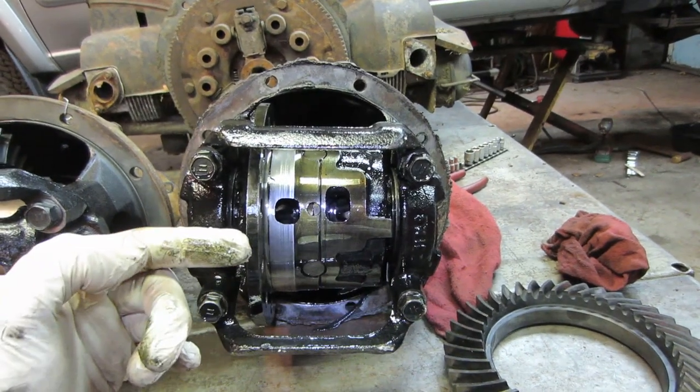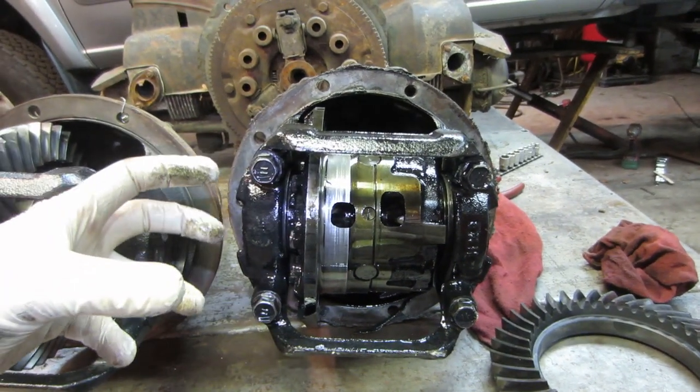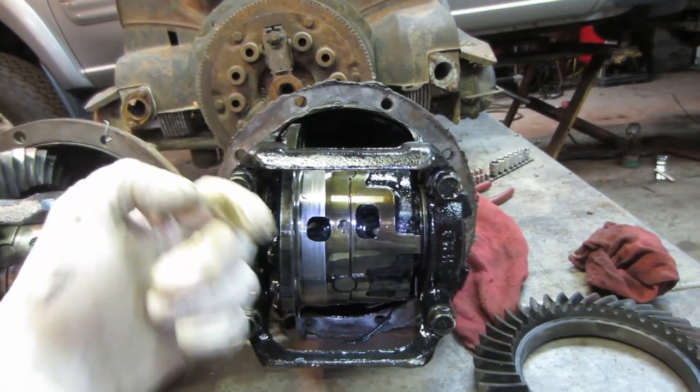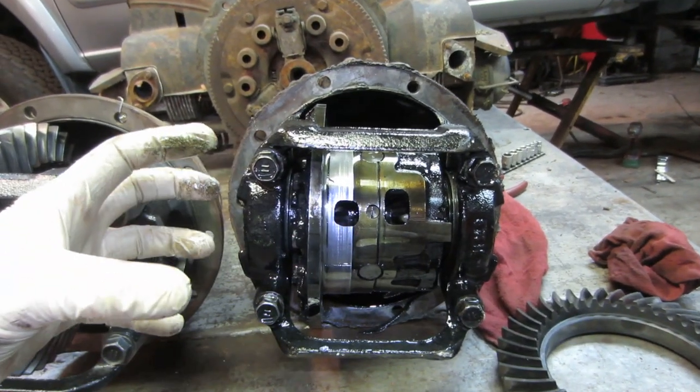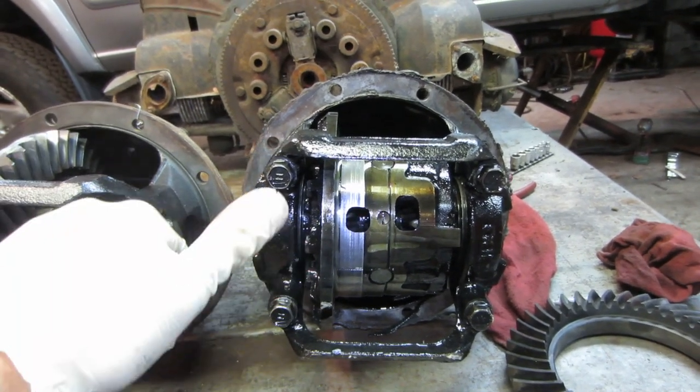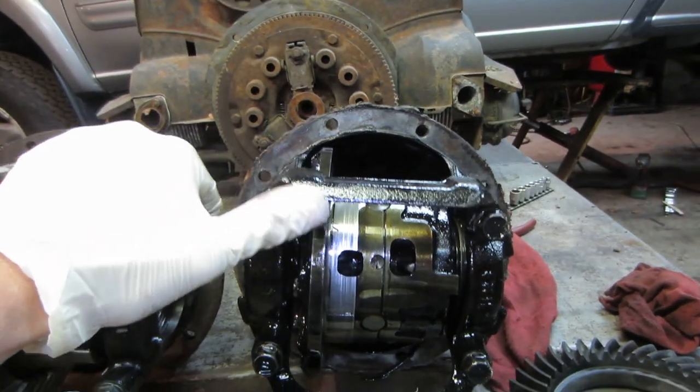On an open differential, there is no longer any traction going to this wheel. If that wheel's allowed to spin, all the energy exits out of the differential on that side, and there's literally nothing happening over here. That's why you're stuck. Or if you lift a tire off the ground and you're going over something, it just spins in the air